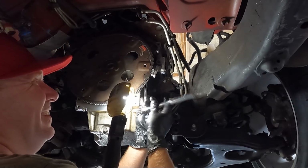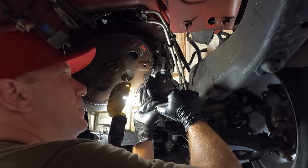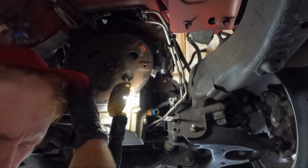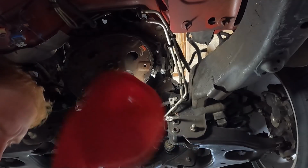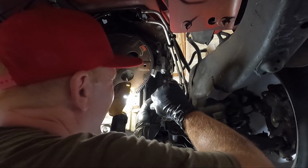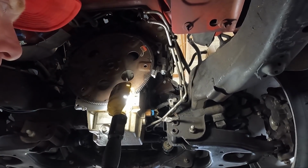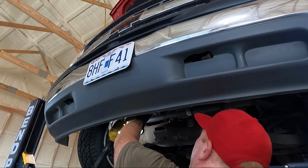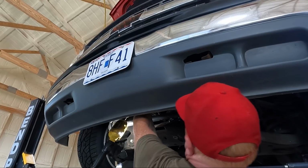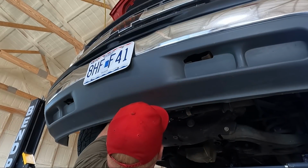And honestly, I think what I'm gonna do is I'm gonna pull, because it's easier than trying to snake the harness off of the engine, the way the harness is structured, I think I'm gonna pull the whole harness off with the motor, is what I'm gonna do. And I think I'm bleeding because I hit my head on the bottom of this car. All right, so we got this thing locked in. Let's see if I can get a 24 millimeter on the crank up here and get it loose with the big, huge breaker bar. So I've got the 24 up here on the crank, got my breaker bar. And so now we're gonna attempt to loosen this up. I don't know if that's what I was afraid of. I don't have a gob of hold here.